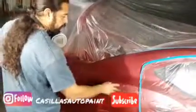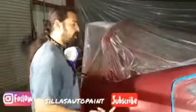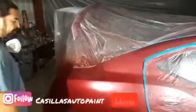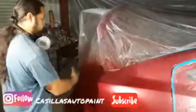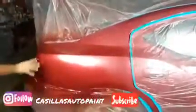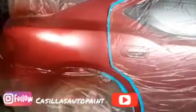So basically it fogs on the paint, because you don't want to change the color here, because this existing color matches with the doors. And you know, red fades right away. If this car is 5-6 years old, the red over here is not going to be 100% the same as the one here. So even though it's color matched, you want to blend it in. You put the paint here, fog it out that way, and that's what I did. This is all the area where that was damaged, and you can see these 3 coats are perfectly back to stock normal now.